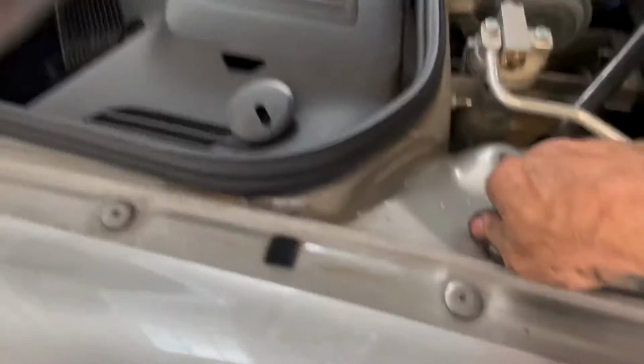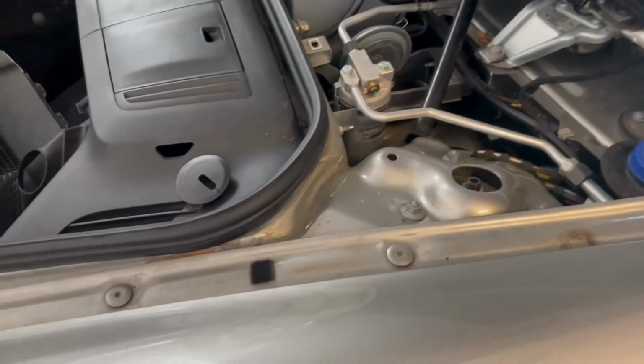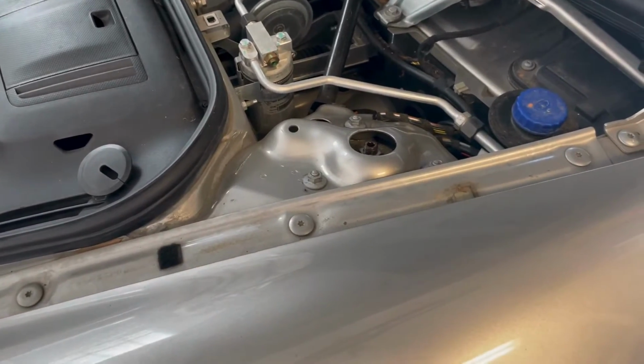That's off, tie rod out. And then we can slide our bolt out that was holding in our sway bar linkage. It's hard to do everything one-handed, sorry folks. That'll just slide out. Now, come back up the top side, loosen, take these out all the way, and I will do that, and then everything will be free. And I'll show you how to get the strut out from there without using a spring compression tool.